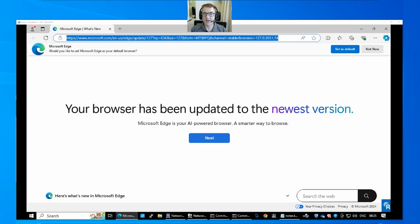Internet service providers, ISPs, do have some system of caching and connecting current devices to your account. And that can take maybe 30 minutes. For some people, it can take an hour or a couple of hours for it to clear after you've had one of your other routers, or your old router, disconnected. So getting this set up now probably will at least prove to you that it's all working and configured, and then you can remove your old router and plug this in.